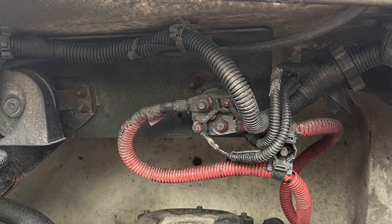Just got off the phone with Chris, the mechanic I used back in Ocala - used a lot when I had the Ford. We troubleshot through it - I had said it was the relay, but it was actually the solenoid. I'll show you a picture of it. We made sure each of the big wires had power, tried to jump it - it clicks over, but it doesn't actually start the engine.